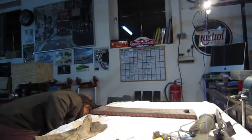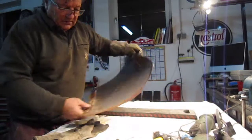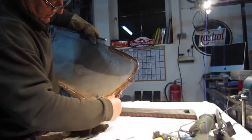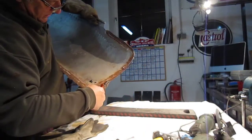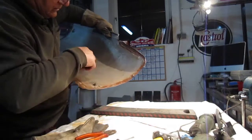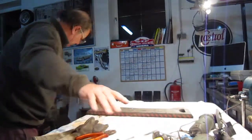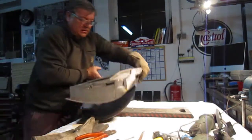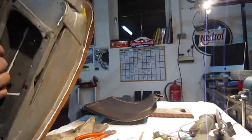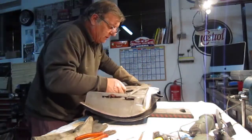I'll put that to one side and show you — this is the original door, this is the door skin from the other door. You can see how bad it is — it's so badly rusted. But you can see the edge: it's almost through but I haven't cut into the main frame, and that's the most important thing. That skin has absolutely had it. Like in all good cookery programs, this is one I did earlier — the skin is not on obviously, but you can see I haven't touched any of these areas and none of them are damaged whatsoever. So I can easily fit that back in. It needs sandblasting now.